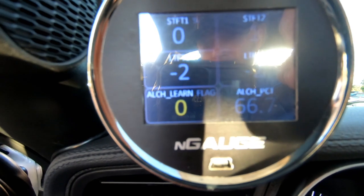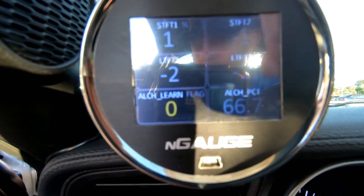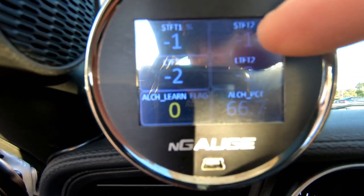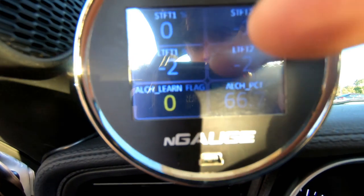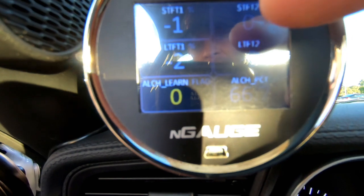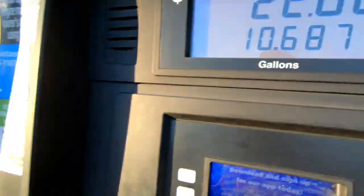Once it's done filling up I'll go drive it and report back on what alcohol value it learned. If it's above 79% or so, I'll throw the E85 dedicated tune in. Then I'll see how far the fueling correction is off — rich or lean — based on the actual ethanol content versus the set stoichiometric ratio, which is 9.89, 10.0, or 9.85 depending on what your tuner uses for ethanol stoic. That will tell me if it's higher or lower than 85% ethanol. It took 10 whole gallons.